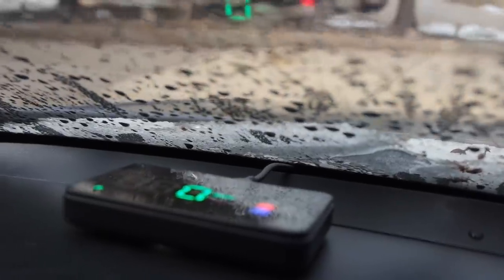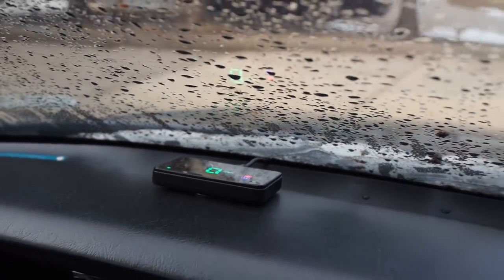One of the main things people ask about in the interior is my heads-up display. A HUD shows your speed directly on the windshield. Since my car is a '94 — anything under '96 is OBD1 — most HUDs require an OBD2 connection. I found one that's GPS-powered. The downside is GPS tends to read about five mph high, so I always subtract five from what I see to know my actual speed.